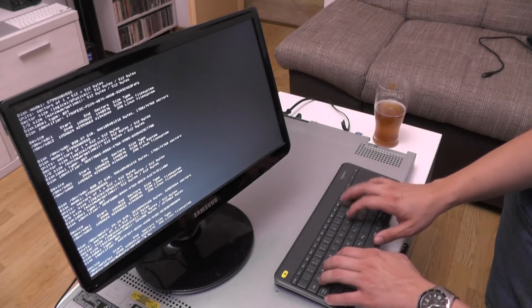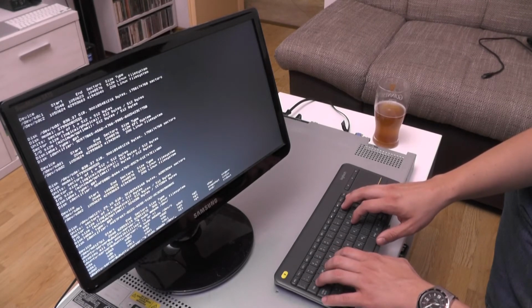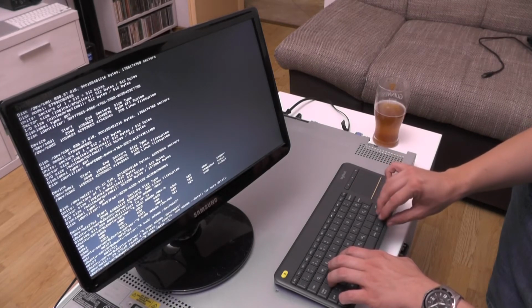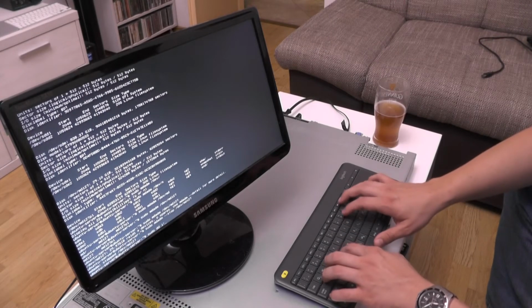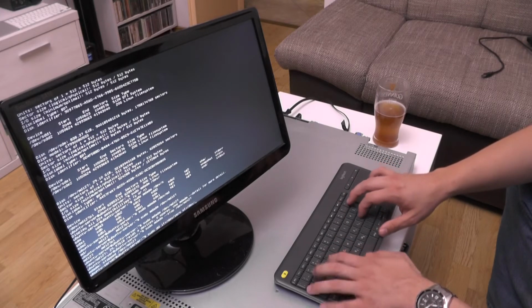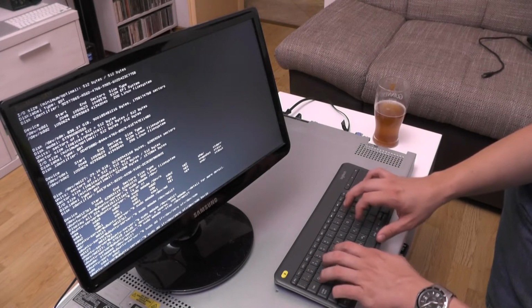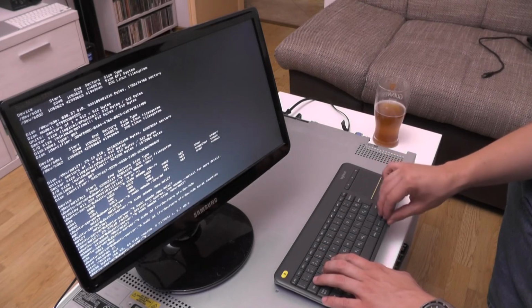Sudo mdadm, I think that's the one. dd if=/dev/zero of=/dev/sde bs=1k count=64 is definitely enough. This is, I think, even too much.